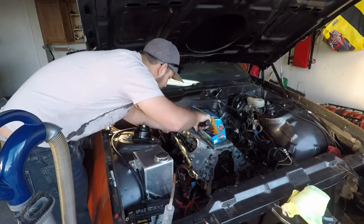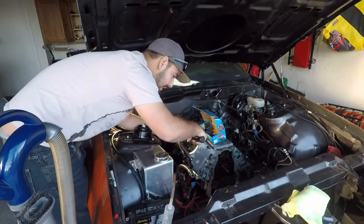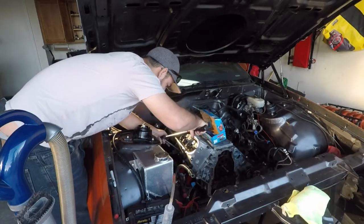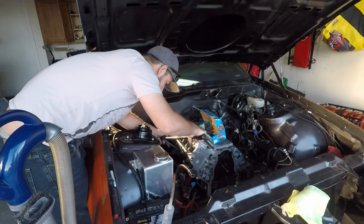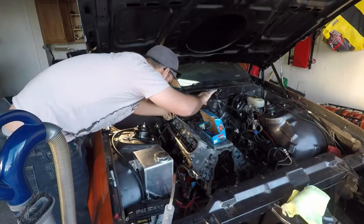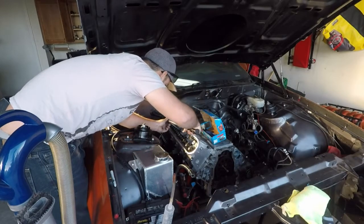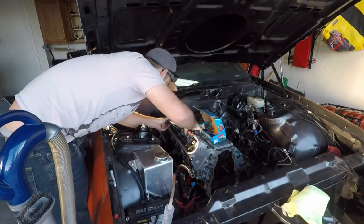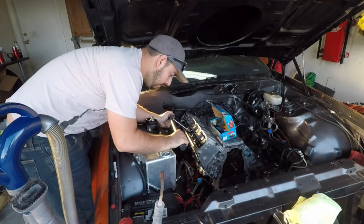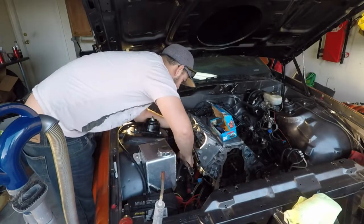You're going to start in the center, and then you're just going to torque. We just had our first click. Now we're going to go to the next bolt. All right, boom. That's our second click. We're gonna go to the next bolt. Oh, whoops. Boom. We just cranked it up to 50 foot-pounds, and we're gonna do our second pass.